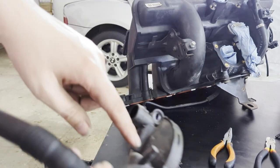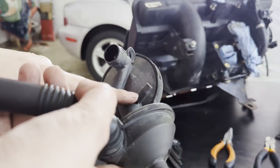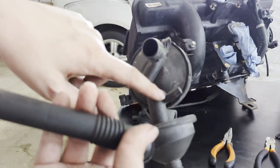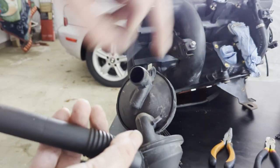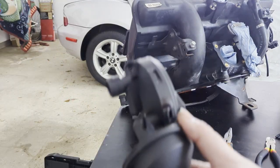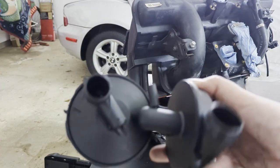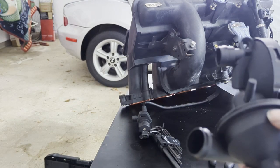Now make sure you take note that there is a vacuum cap right here. Depending on which model engine you have, you might actually have a vacuum connected here, or you'll have a cap. Mine is capped off, so you're going to want to remove this cap and put it on your new one if yours is capped off. Here's the new one — I'm going to put that vacuum cap right on that nozzle because this will give you a really bad vacuum leak if you don't remember to do that. Now this one is ready for installation.